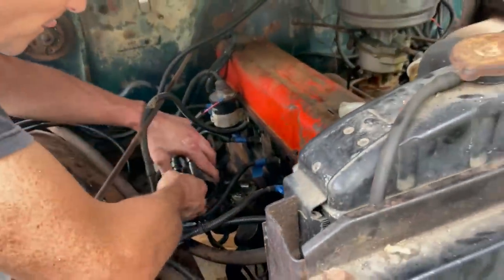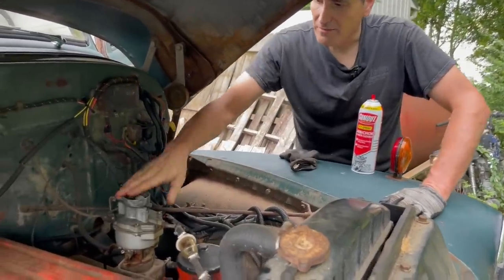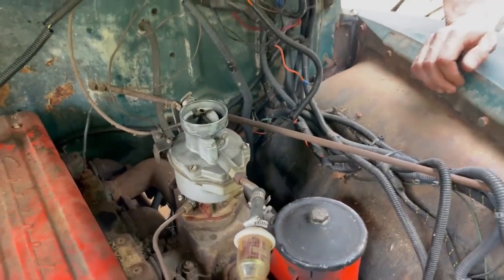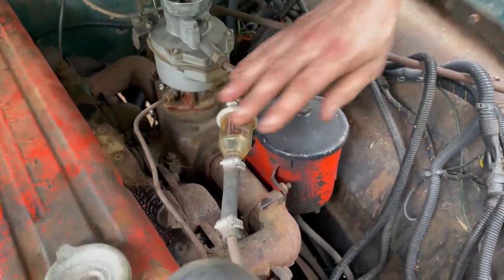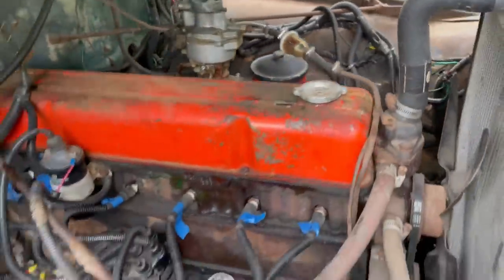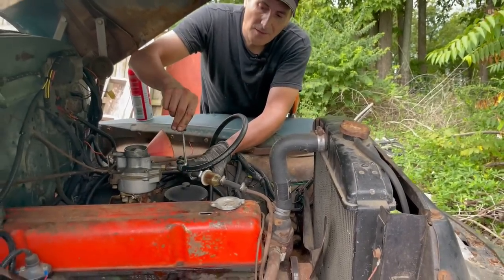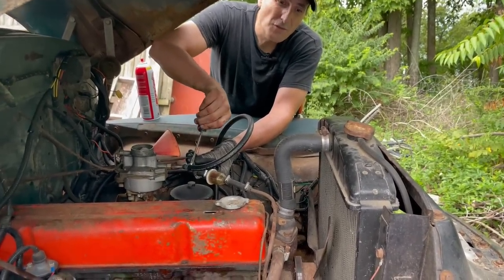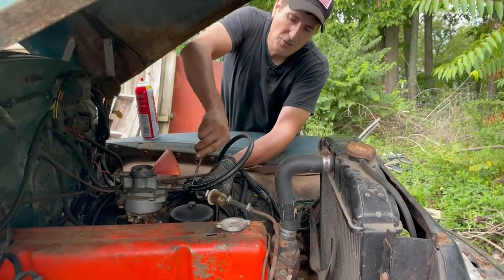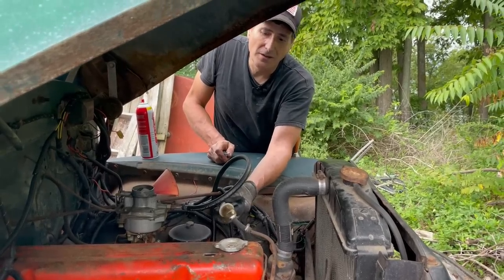Okay, we paired. Okay, carburetor looks great. No problems. I'm gonna check the gas in the tank before I rely on any of this. And if it's bad, I'm gonna hook up my own fuel supply. Okay, all good. Fuel line's going in. I was going to hook it to the fuel pump, but I cannot find a connector that will work with it. So this will do for now. In case it starts pumping, we're going to run this into a can.